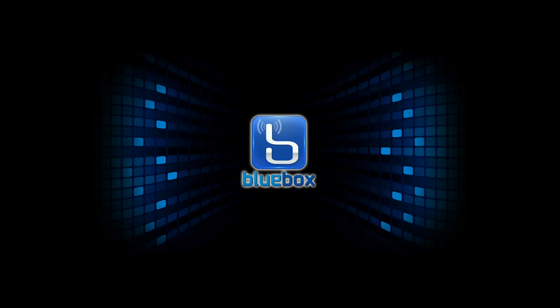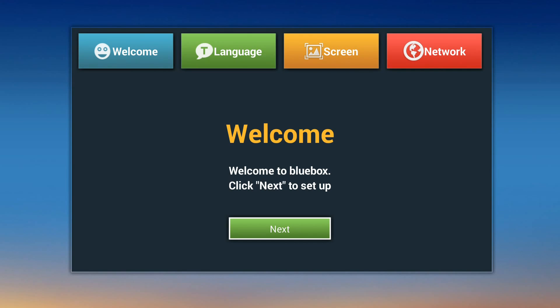It's going to take a couple of seconds to reboot. After running the factory reset, the next screen pops up. One thing to note: sometimes when you do a factory reset, some boxes will show a screen asking if you want to clear cache or clear all data — just make sure all those boxes are checked. Use the arrow keys on the remote to select them and click OK to toggle the checkboxes.